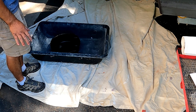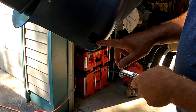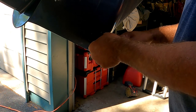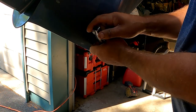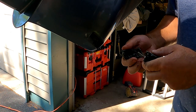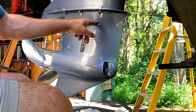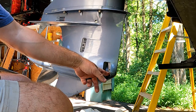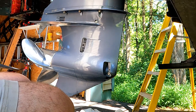I'm fairly well protected from the wind today, so I really don't think I'm going to have any splatter. First thing you're going to want to do is take your Allen wrench and remove the covers for this inlet, or intake. Keep these parts together and set them aside. When we remove the intake cover, we expose the drain plug — two drain plugs, actually. The drain plug becomes the fill plug, and this is the upper plug that we're going to watch to determine the fluid level.